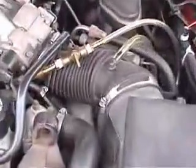I've got to tell you what just happened. Inside, the water reservoir light came on and I thought that was kind of freaky because it was about three quarters full. Now it's totally empty. What happened was our solenoid got stuck open and the water was being sucked right through, and the water trap caught most of it thankfully. Some of it did get through the engine. I immediately shut off that valve.